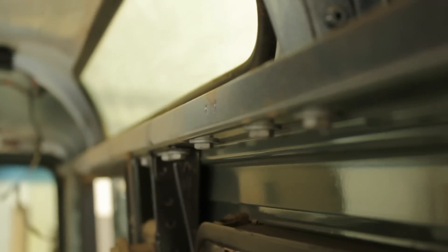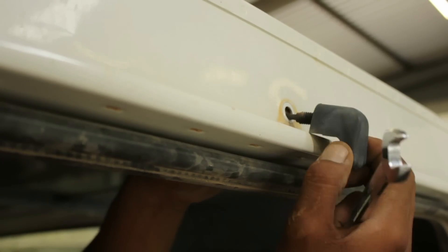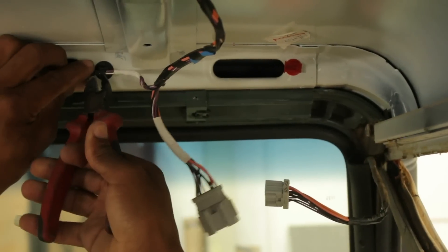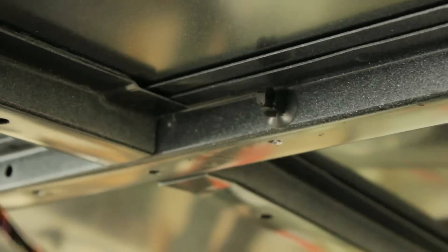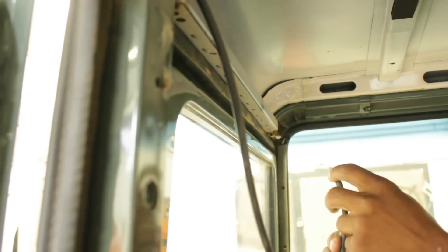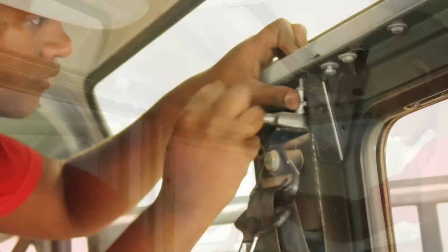Be sure to strip all existing wiring attached to the roof, along with water lines for the rear window washer and plug points joined to the rear wiring. You will need to cut the line to the rear plug, as the loom will not slide out of the existing roof, and rejoin it once the new roof is back in position.